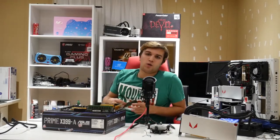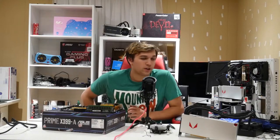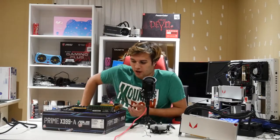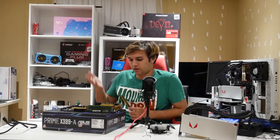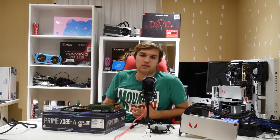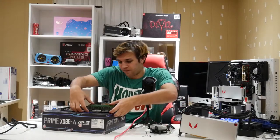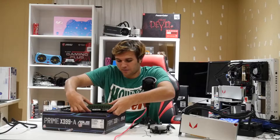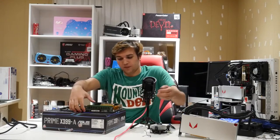Another reason I thought about using old hardware — I could take my other PC apart and rebuild it to make sure everything still works. Older hardware is not as durable. The irony here is this is literally an 'Ultra Durable' motherboard, but every time new hardware comes out it's more and more durable — more resistant to static shock. I'm currently only wearing socks and I'm not wearing an anti-static wristband. I suggest you do though, because if I don't and you break something, you're gonna blame me. RAM installed.